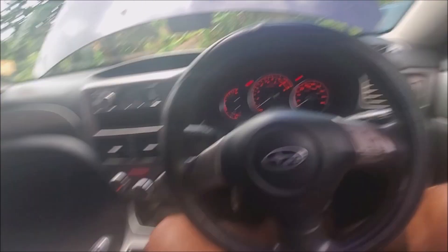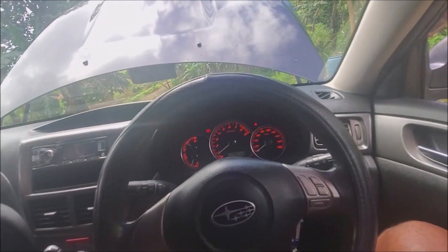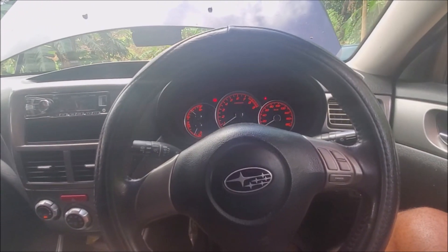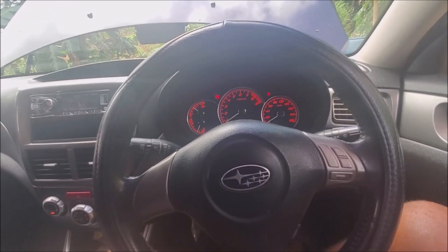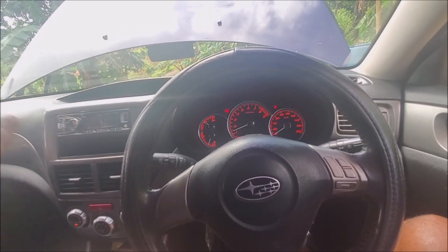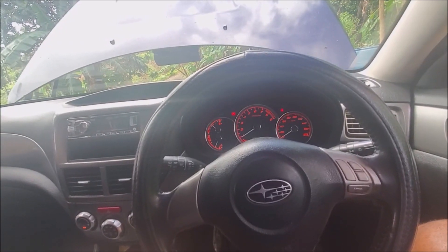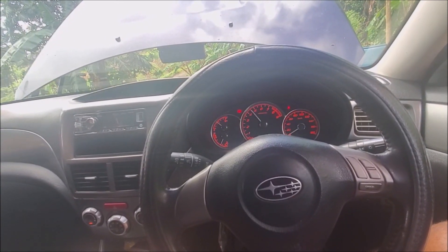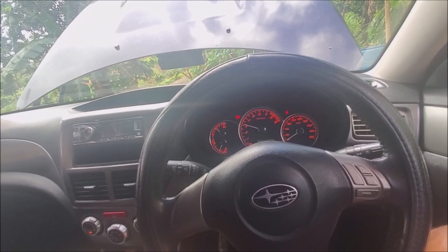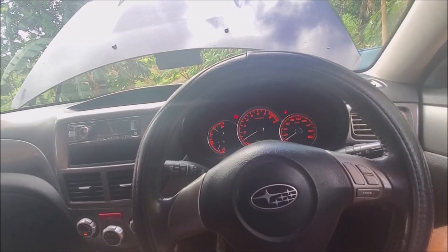On the inside we can see that everything is there — my laptop is there — and the car is running on speed density, same as it would be with the MAF airflow sensor. I'll show you that you can rev it up, and now you can actually hear the blow-off valve sound. I disconnected it for the demonstration.